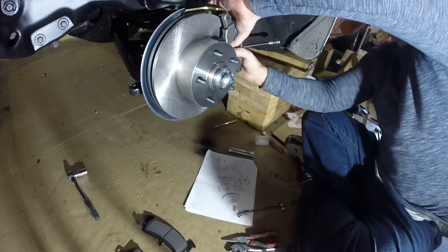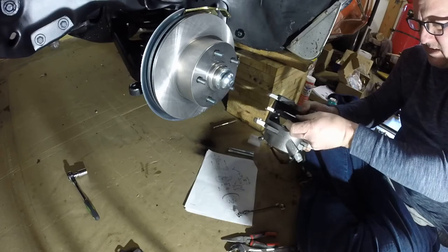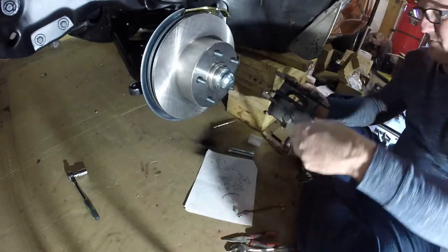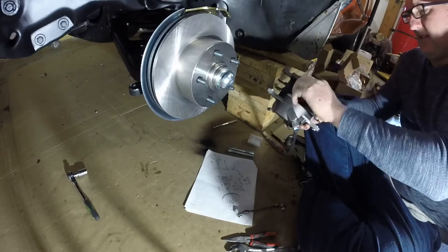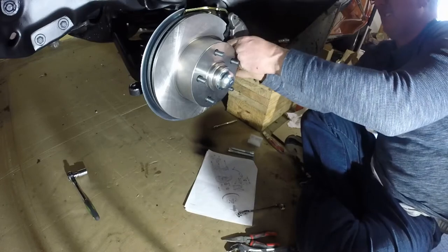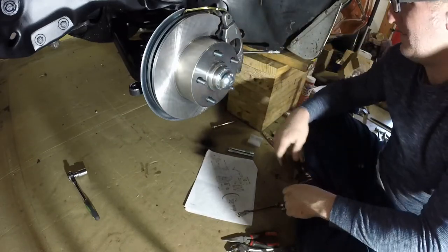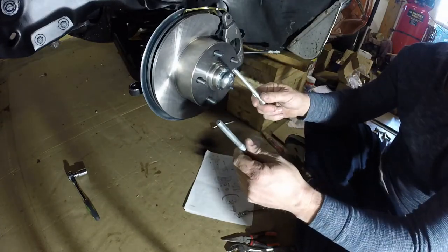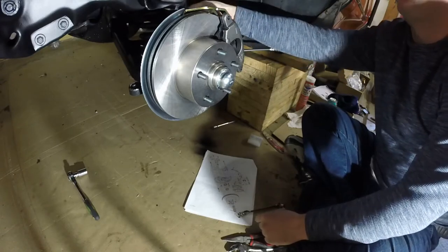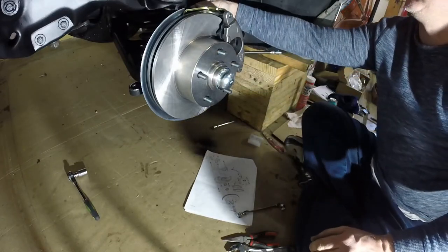I dry-fitted the caliper here just to get a feel for it — it's a relatively tight fit between those two, but hey, that's a good thing. I'm going to go ahead and put my first pad on here. Let's see if we can get these both on at the same time. Looking good so far — just got to fit in between this bracket. That's in now. We've got these two bolts to drive through the back side — we'll do this top one and the bottom one.